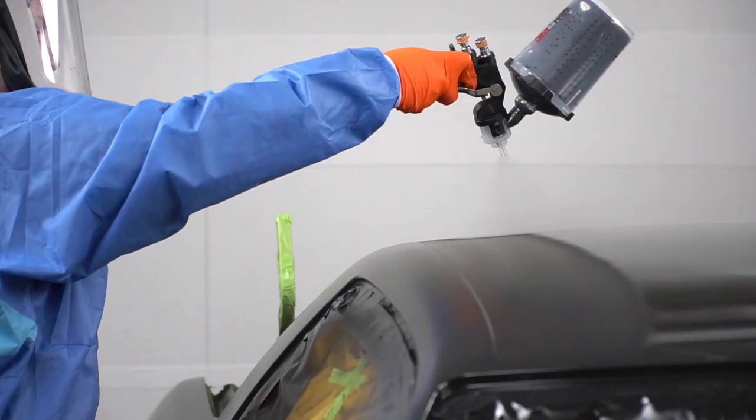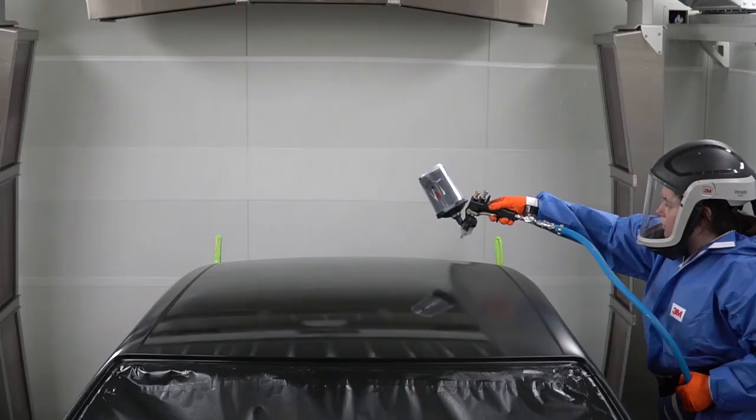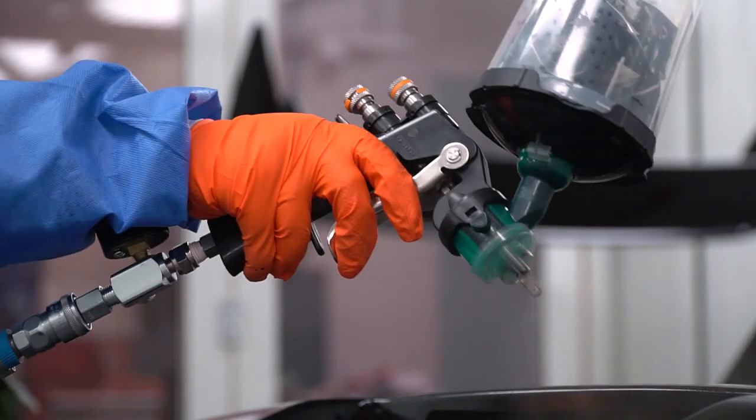One of the main techniques I learnt from painting a full car was that I had to keep a wet edge from start to finish — that was something I had to get used to as I went along. Luckily, I got a bit of a test run when we high-filled the car, because it was the same technique just with primer. Then we did the same with base coat and then the same with clear. I asked a lot of people a lot of questions on what they would do, what their approach would be, and I definitely took it all on board.